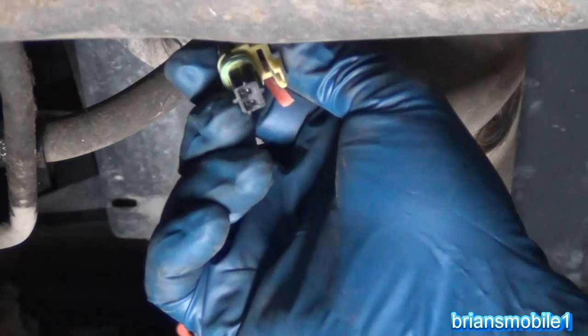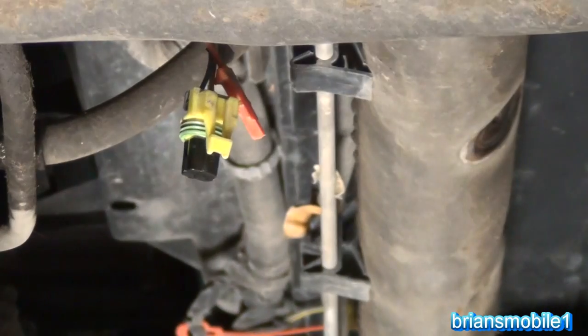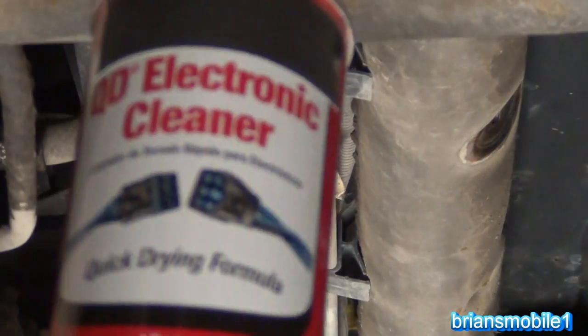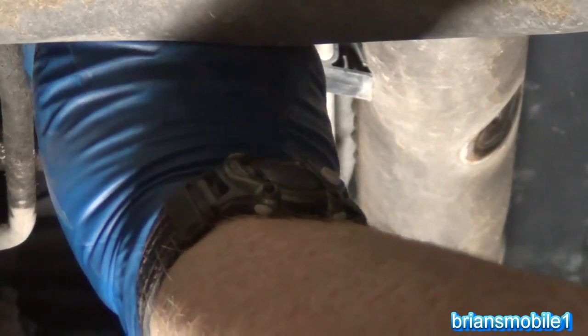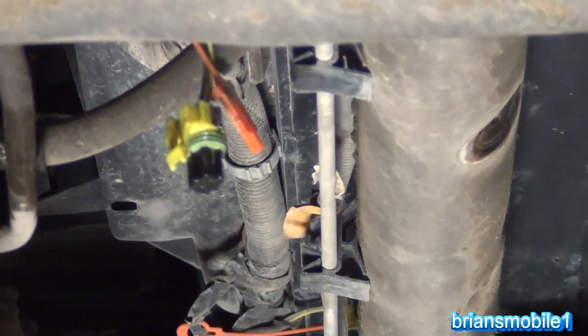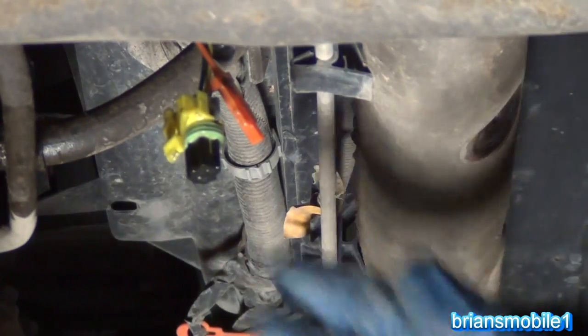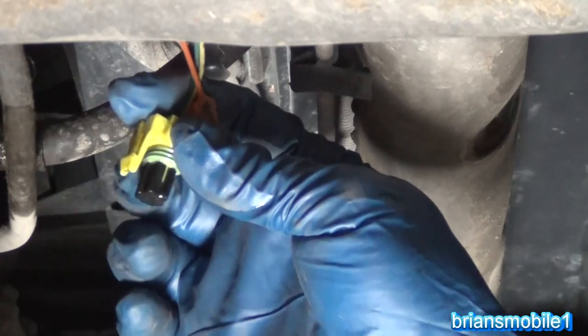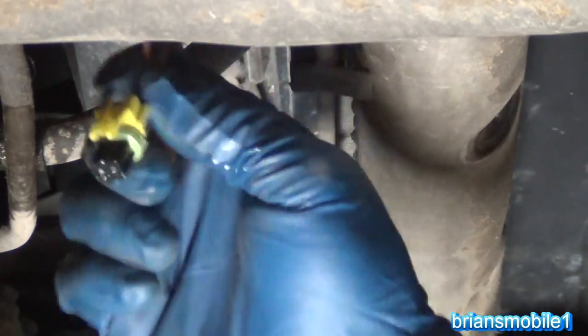While I have this unplugged, the connection looks really clean to me — I don't see any problem with it at all. But I'm going to go ahead and clean it with some electrical parts cleaner, pointing it up to clean out the back. Make sure there's no mineral or whatever that's causing conductivity between the two wires. They've got a little silicone rubber type boot in the back. You look at all the grit and road salt and all the stuff that gets in there — there's a good possibility that something's conducting.